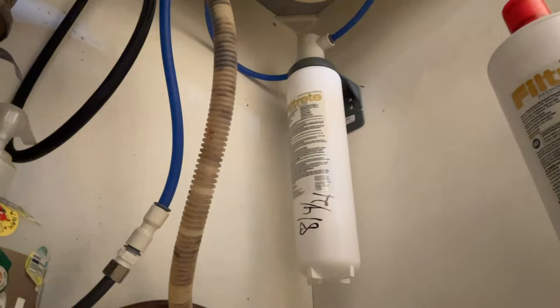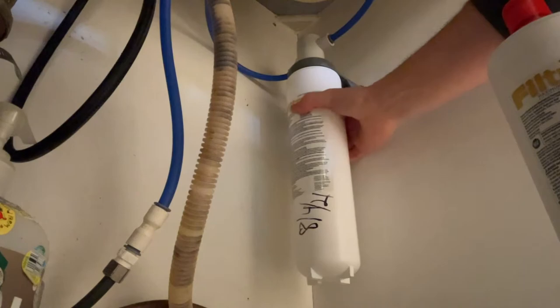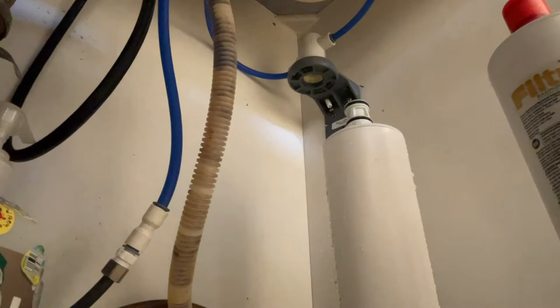You don't have to turn off your water line — there's a spring-loaded valve in the top, so it doesn't matter. To replace the filter, don't shut off your water or do anything special. Just go ahead and turn it clockwise — towards you basically.